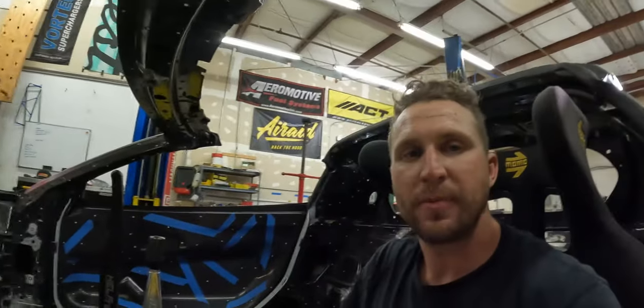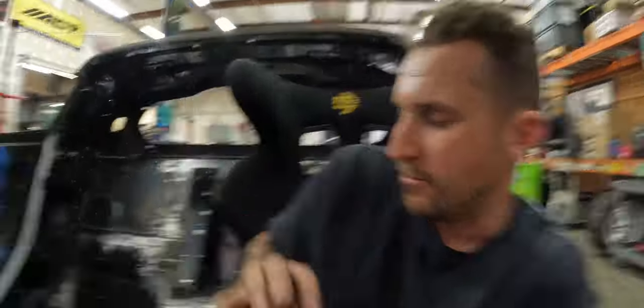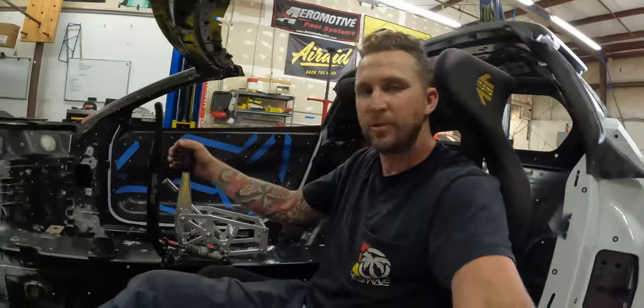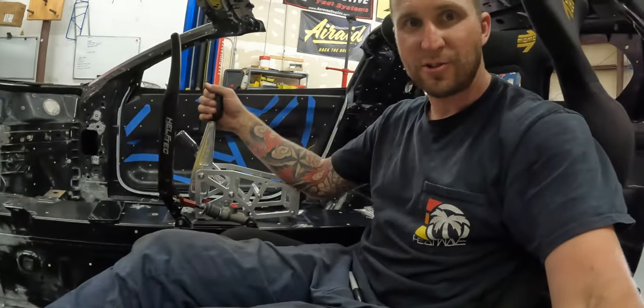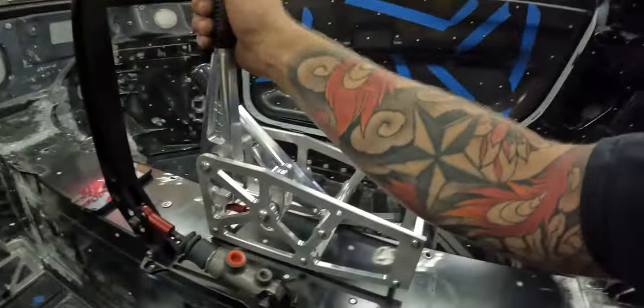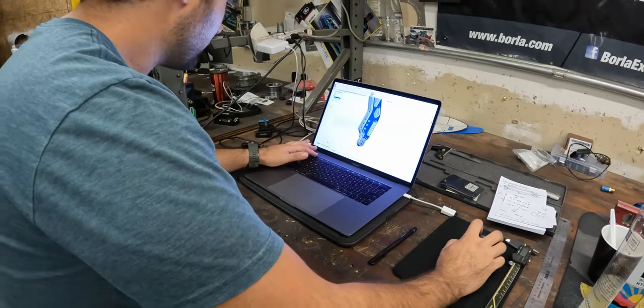I measured the race car from the firewall to the center line of the handbrake — 39 and a half inches. Got that marked up, and then offset back three and a half inches from the handbrake center line. It feels a little intrusive to elbow room, but if you're shifting normally it's no problem. If you try to hit it you can, but it's relatively normal shifting. Now we just need Chris to bring up the model and make a game plan — pedals bolted in and this crazy shifter is pretty cool.